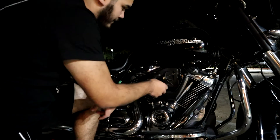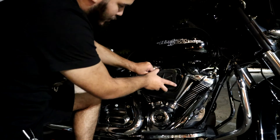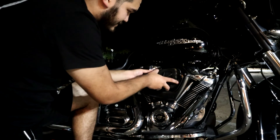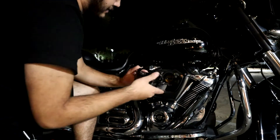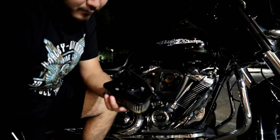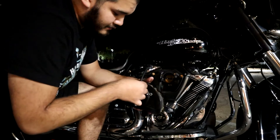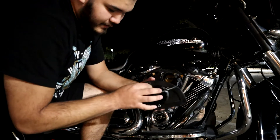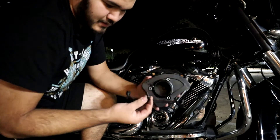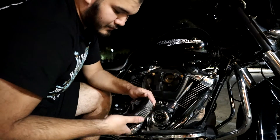When you pull this off, you're going to have your oil return lines here, so make sure you pull those off - they should have tabs on them. Just like that, you have the air filter off. The oil return line is going to have a tube that goes inside the filter, so you're going to want to gently pull that out, make sure you don't rip it, and set that off to the side.